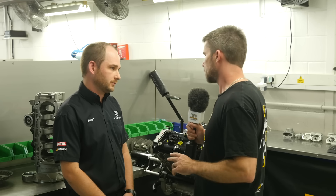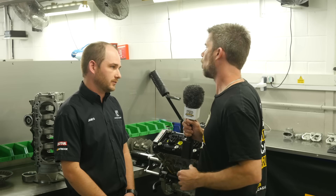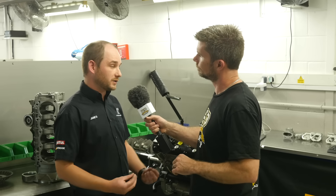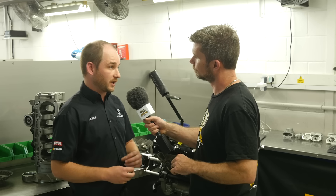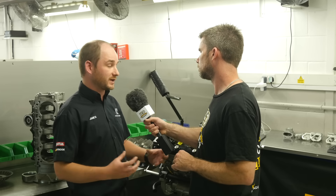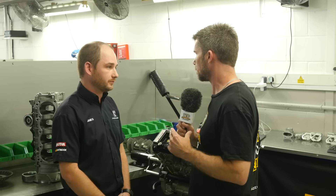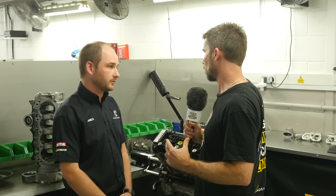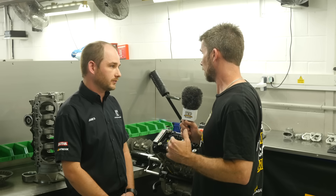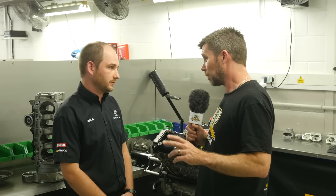You've mentioned your big pin crank versus your small pin crank — can you elaborate on that? It's basically the overlap between the big end and the main journal. We've increased the pin overlap to create a stiffer crankshaft that's able to handle more power — essentially increasing the rigidity of the crankshaft and making it less likely to fatigue and fail. Exactly, yes.